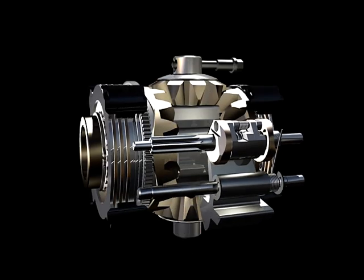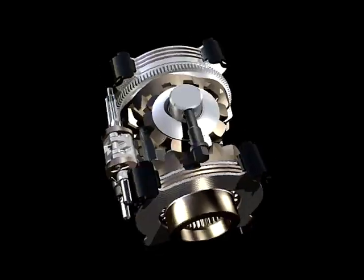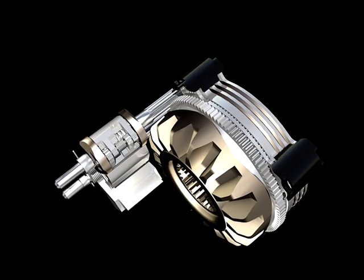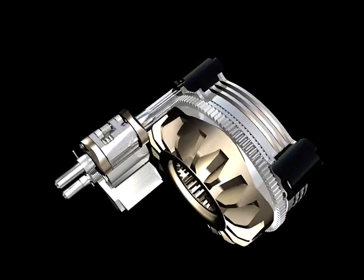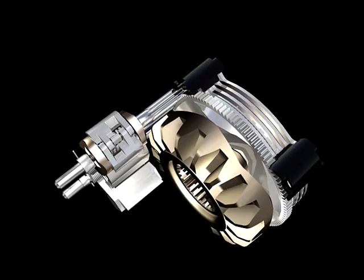With the parts back together, it can be seen how all the parts work to cause lockout. With one wheel spinning, the cam side gear rotates relative to the case causing the engagement mechanism to rotate at a higher speed. At a given speed, the fly weights will swing out and engage the paw on the lockout mechanism. This action creates a force to be exerted on the cam plate, allowing it to rotate out of the detents and into the ramping position.